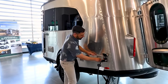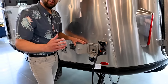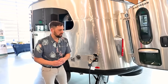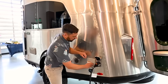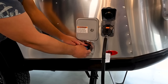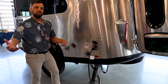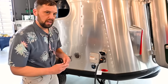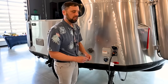Opening this door, this is the fresh water tank fill — 21 gallons of fresh water you can hold on board. It has a combined gray and black waste tank: gray for sink and shower waste, black for toilet waste — a 24-gallon tank that is heated just like the fresh water tank. Below that is a city water connection, which allows you to supply water pressure to all your plumbing on demand using the campground's water pressure. It also has a water pressure regulator built in for unexpected pressure spikes. Note: city water does not fill the fresh water tank — it bypasses the tank because there's a check valve built into the water pump.